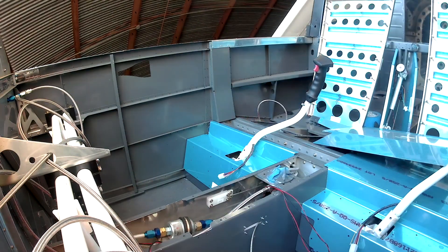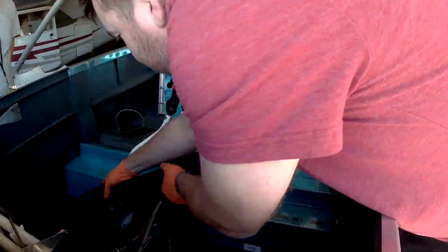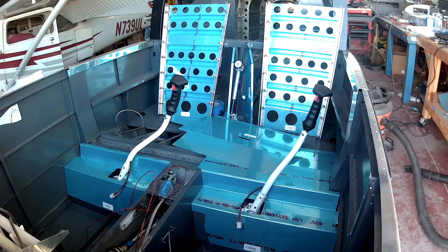I'm using the Fly EFII fuel injection and ignition system — that's right, this plane is going to be in the 1980s, damn it. We have electronic fuel injection. Now that it's in, I could run the pumps, but I'm not going to, because there's no fuel in them — you don't want to overheat and blow the seal.